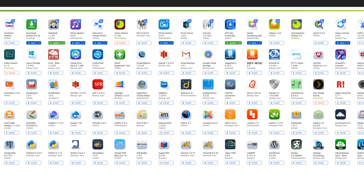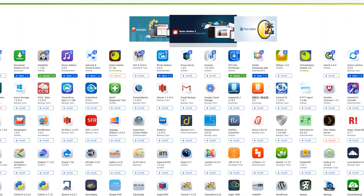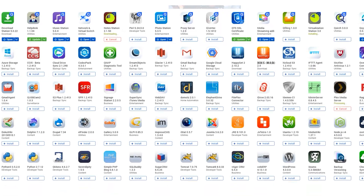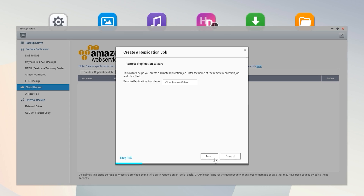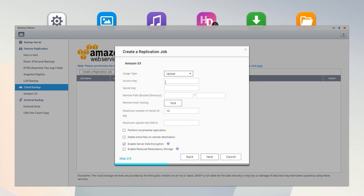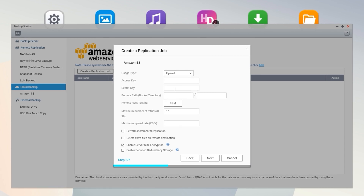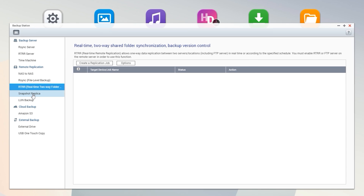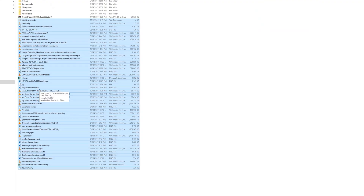With a heap of different apps available, I wanted to see how the TS251A could benefit my workstation needs and see what apps I really liked and why. The ability to automatically back up data in RAID 1 configuration — confirmed. This is easily done via the App Center, where you can upload and sync automatically to a variety of cloud servers and schedule automatic backups. It did take around 20 minutes to back up 22 gigabytes of archive files via the gigabit ethernet connection.